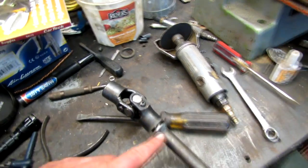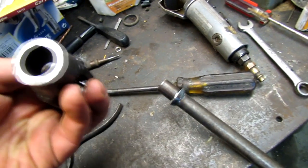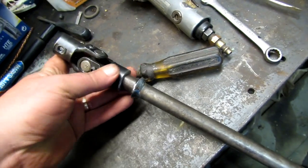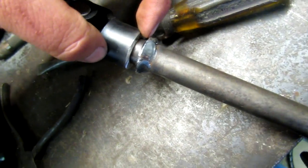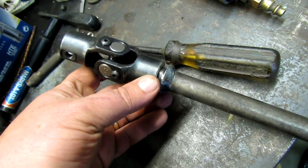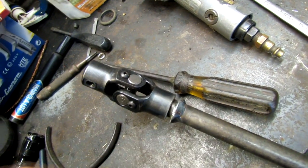Alright, I've removed the steering column and everything and cut just behind the weld on the shaft. I've removed the U-joints in phase — now I'm going to grind that weld down. I did over-cut just slightly right there on the shaft. I think that's going to be okay — I'm just going to leave that U-joint out about like so. I've got the room to do that, then weld it up real good.